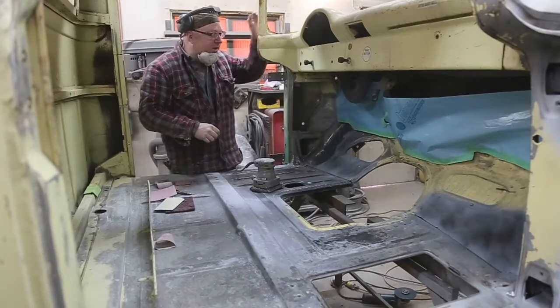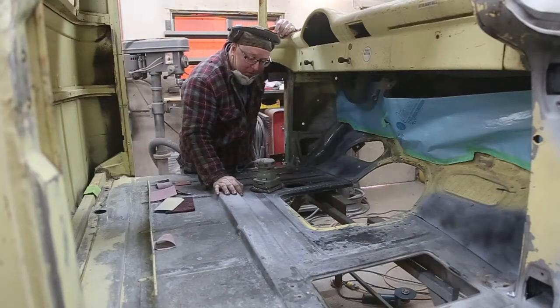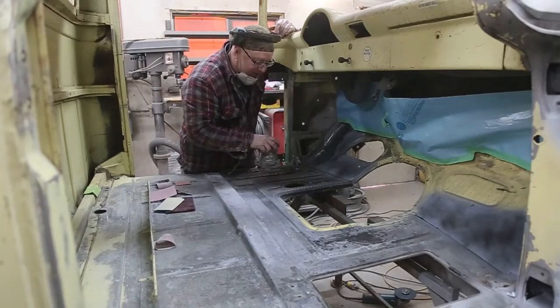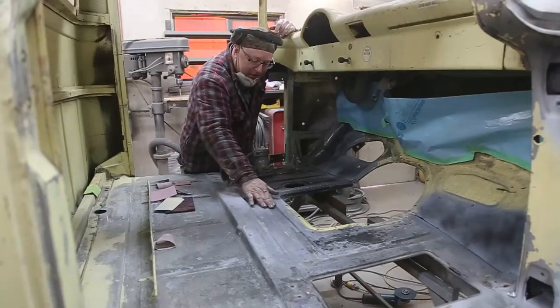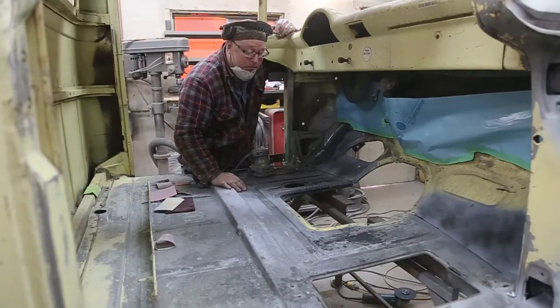We're just finishing up the sanding. We've got to sand everywhere where there's going to be paint. Remember, if it's not sanded, she ain't sticking. So make sure we do our panel here. I just sprayed a little guide coat on and once we got everything scuffed up we're ready for paint.